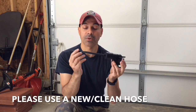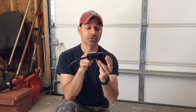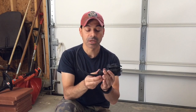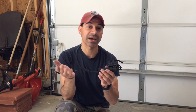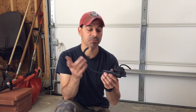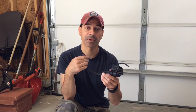Basically, what you have here is your input where it sucks air in. It runs through this filter where it goes into the solenoid and opens and closes it, directing it from that point. If this is stuck in the open position, you would be getting like a vacuum leak because it wouldn't be closing as it should, which could cause engine problems. I'm going to go ahead and blow through this end of the vacuum line and see if we hear any air coming through.